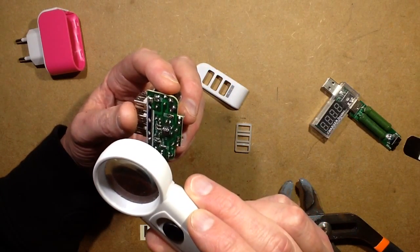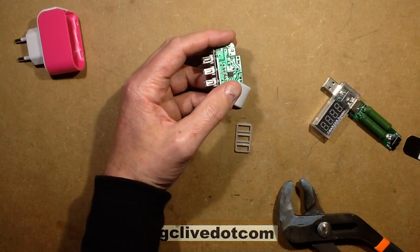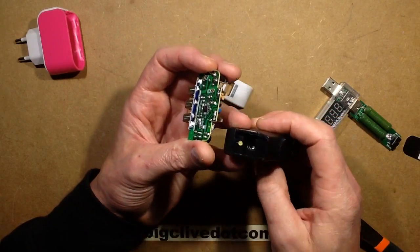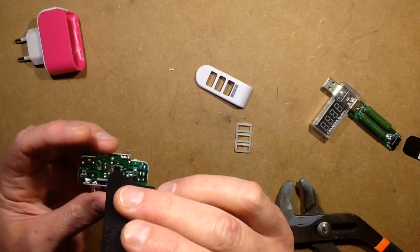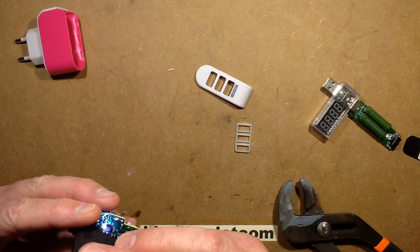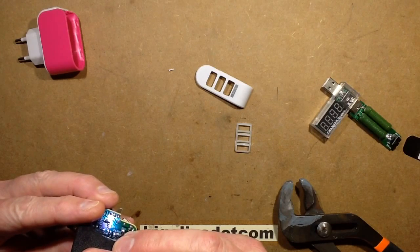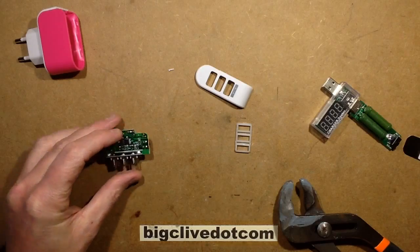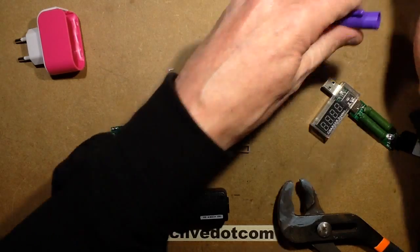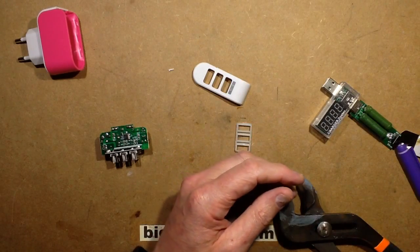Where's my little microscopy device? This is a little microscope that I've burst the end off — it comes from eBay, it's a generic Chinese popular item. It's got a little LED in the end and it kind of works pretty well at focusing on smaller objects. Let's see if I can find the chip on the circuit board. There's the chip and the number on it is HC 2513. I'll note that down — HC 2513. Remember to turn this off because if you leave it on it runs the batteries flat very quickly.